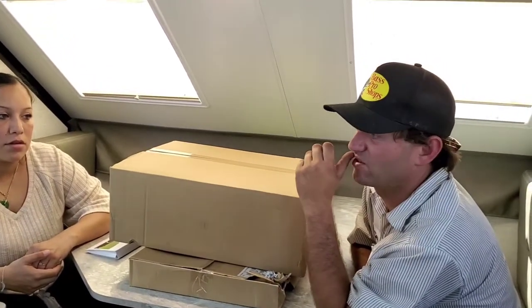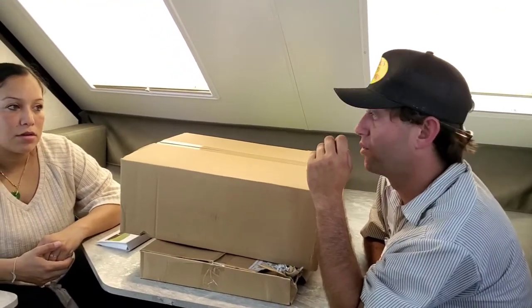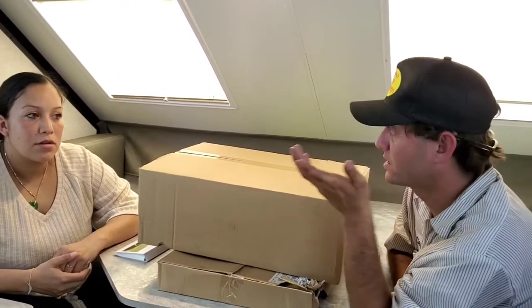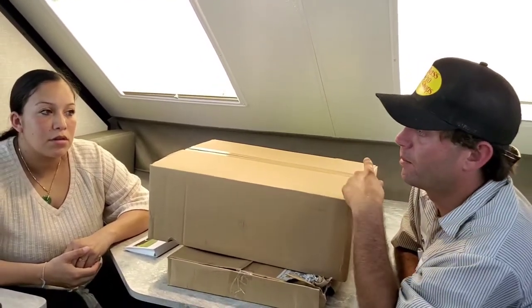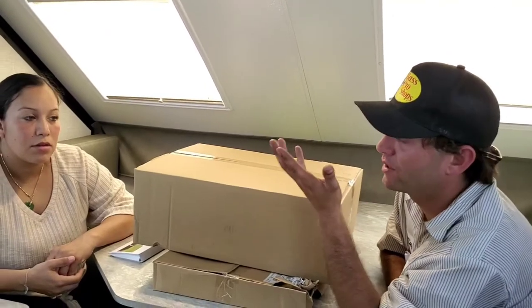Have brake control. If it doesn't have brake control, we'll talk about that because that's kind of important. These trailers have brakes, electric brakes, and if you have a 7-way already, is there a 7-way on the vehicle? Yeah. Okay, then it should have something pre-wired. It should be pre-wired for brake control, so if you don't have one, you might want to get one,